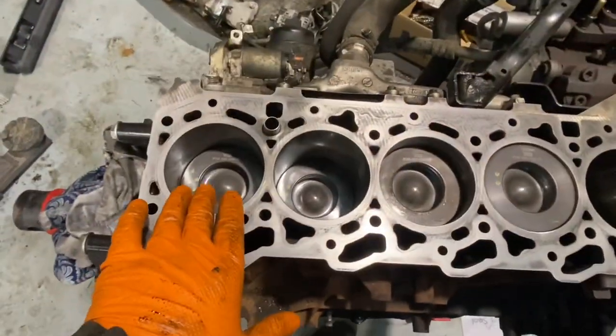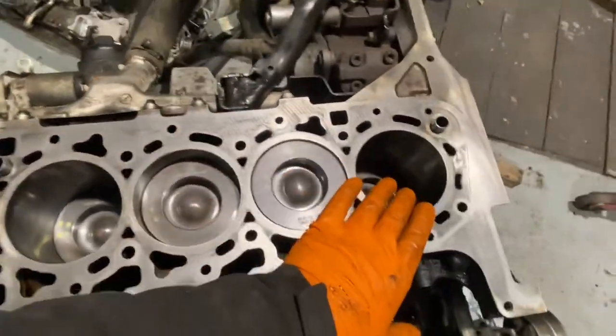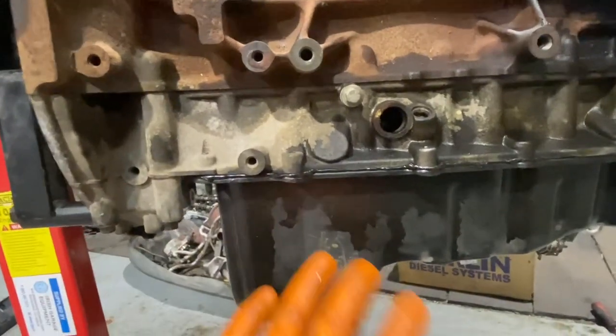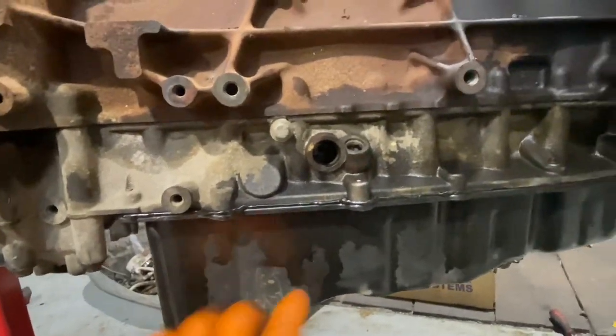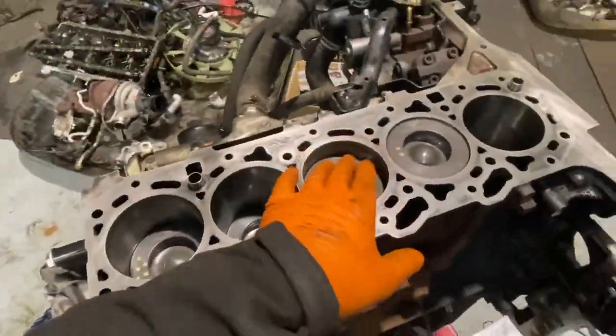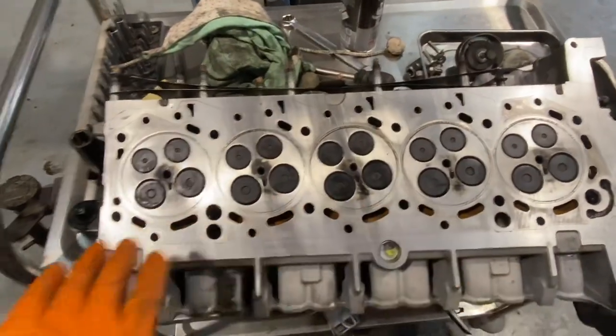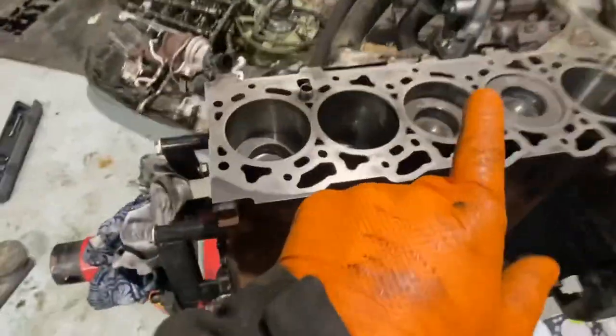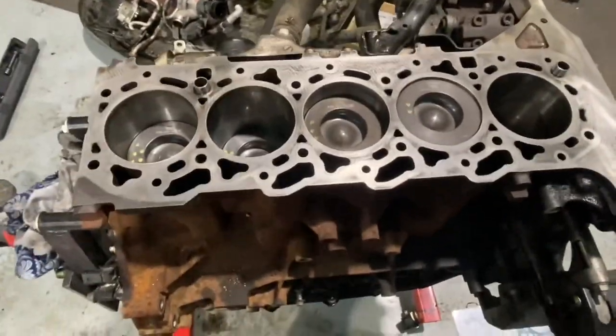Okay, guys, I don't know. All my five pistons in. I don't know if I showed that already. Have the base plate thing on, some carrier, whatever the hell they call it, I don't know. Sump was bolted on. My timing chain, the little small one I showed you for around the oil pump, and my oil pump assembly fit together in here. I've given it a run of sandpaper and stuff. I have my cylinder head here cleaned up and ready to go back together. And then my gasket is sitting here on the ground. So that is going to be over to that in the next few minutes.